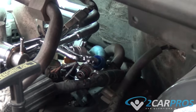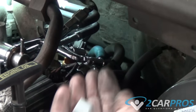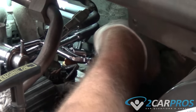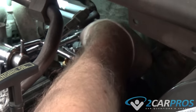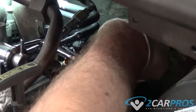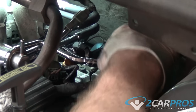Reconnecting the fuel lines is a bit easier. So we're going to remove the protecting cap or cork that we put on the end of the fuel line. Then we're going to take the fuel line side that we disconnected — the one that's mobile. Some are braided so it's a little bit easier. You're just going to push it back where it was, and you should hear and feel an audible click from the quick disconnect. Sometimes if they're a little bit older the click won't be as robust, but once you have inserted the fuel line firmly you can reattach the safety clip that we removed earlier.